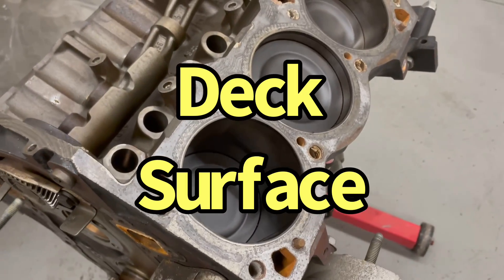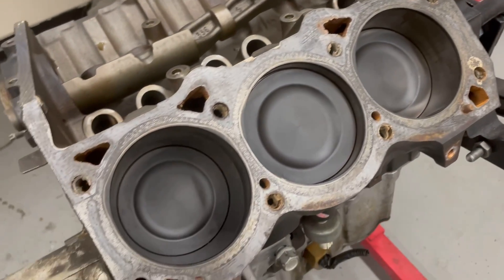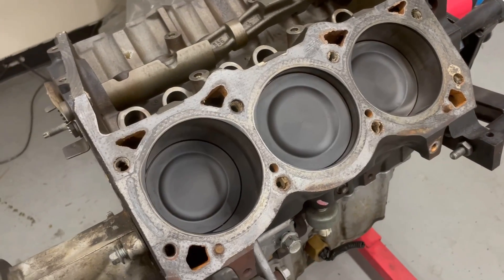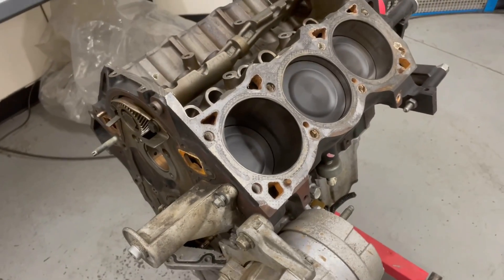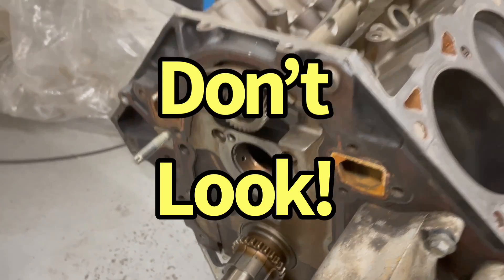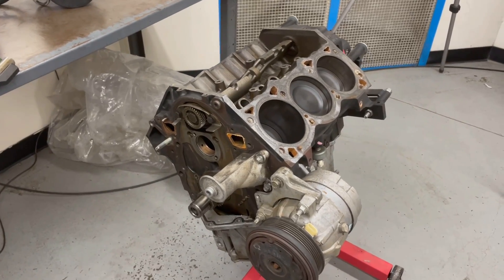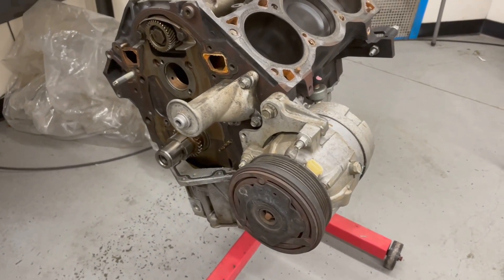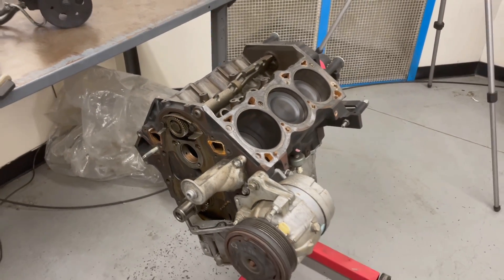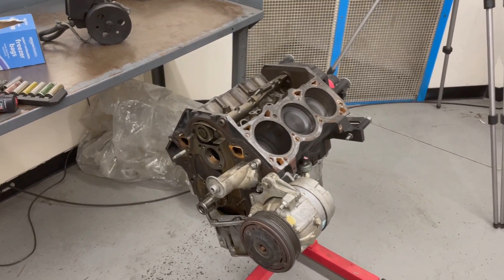We need the right RA finish so it will work with an MLS head gasket. I'm going to number the pistons, take them out, put ring gap in them, then have the block cleaned and put it all back together with the original stuff — bearings and all that. I've got a custom cam, ported heads, a ported intake and a little custom elbow on it. So right now I'm going to take these pieces off, strip this thing down, take the pistons out, put ring gap in, have the block machined, put it back together and hopefully — fingers crossed — big bang 3800.